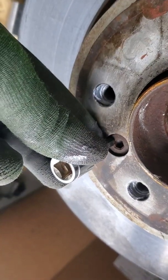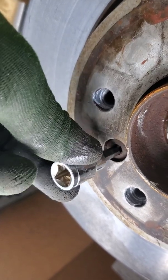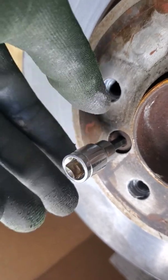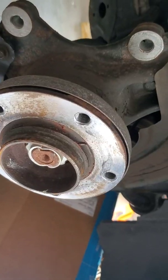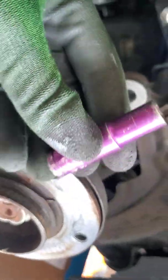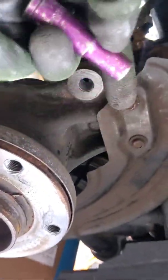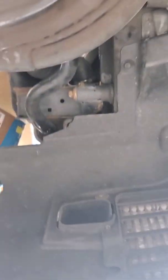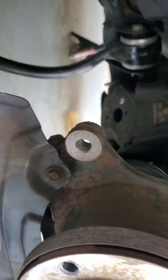Make sure you remove the 6 millimeter hex nut here — just get a 6 millimeter socket and you should be good to go to release the brake rotor. The rotor is off, and I'm going to use a 10 millimeter socket to remove the nuts so you can remove the shield. There are one, two, three, four of those nuts that you need to remove.